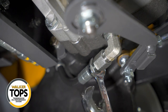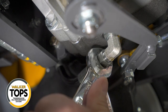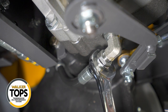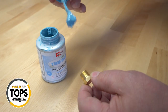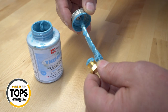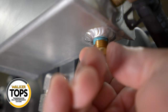Now we'll reconnect the lines between the oil pump and the transmissions at the elbow connectors. Use a 12 millimeter wrench here to keep the hose from twisting as you tighten these hoses back into place. The plug for the reservoir tank is a tapered pipe thread, so we recommend using a pipe thread sealant when you reinstall the plug. Then we'll reinstall the reservoir drain plug.